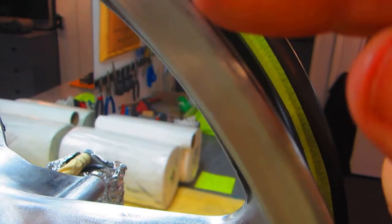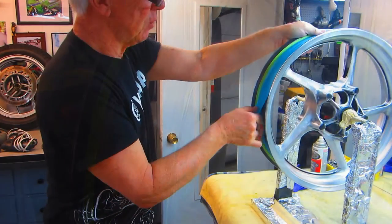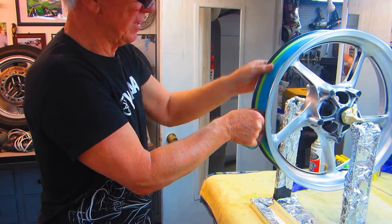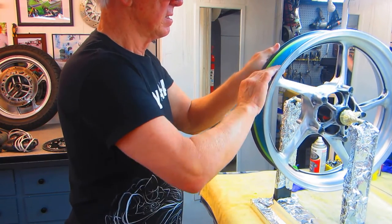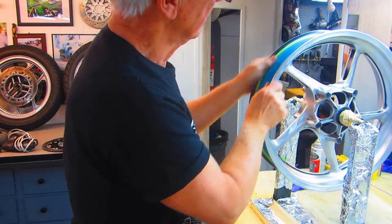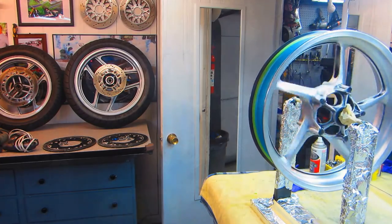Now I just need to back-mask the center and we're ready to paint. This is about how far I'd go out onto the rim on both sides before masking. I want the paint to wrap around on both sides — I don't want a fuzzy line right at the tire edge; I want a razor edge where the paint ends and the tire begins. I'll do a final prep wipe one more time. I've seen people just paint the whole inside of the wheel — I guess you could do that. I prefer doing it this way — old school. Everything's back-masked, ready to go.